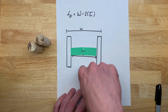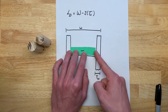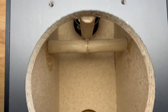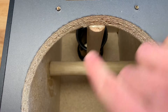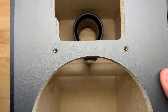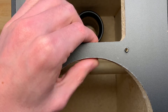The dowel going forward and backward — if you want to add a second one — can be one piece; you do not have to make that in two pieces. I also recommend having one end tapered or beveled so that as you stick it through the woofer hole and shove it up, you can make this one in all one piece. As you press it, it should be taller at one end and shorter at the other, so that as you push it up, it will push the forward face and rear face further apart and wedge it in there really tight.